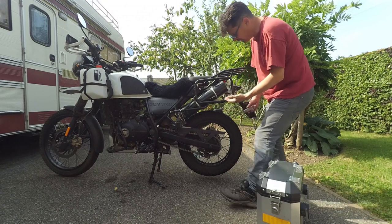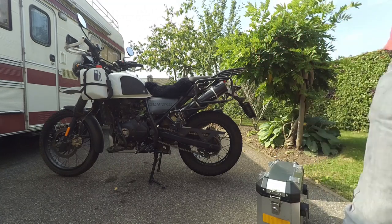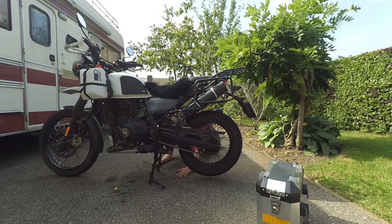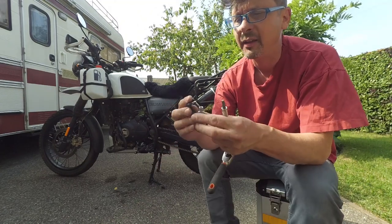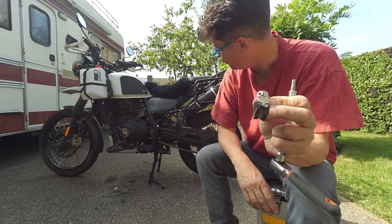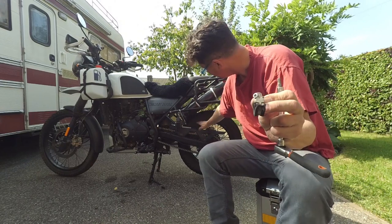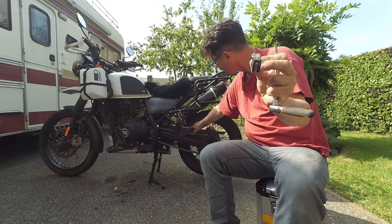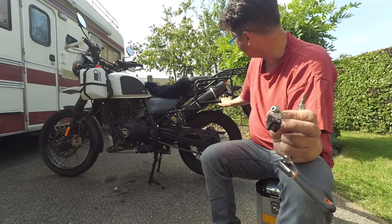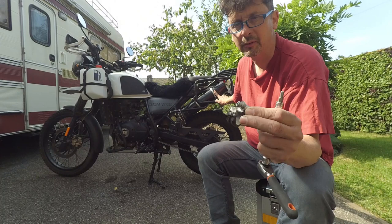That was a bit of a fix when it came loose on Banky Barn — just a couple of cable ties. You can see here the P-clip has actually snapped. I'm pretty sure the reason is I didn't have it rigidly enough fixed, so when it kept hitting the chain guard it was repeatedly stressing it and eventually broke the P-clip. I'm going to replace all the P-clips on this one, and probably on the other one as well.